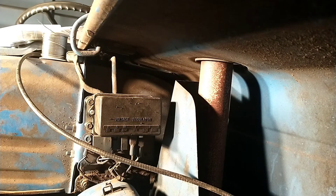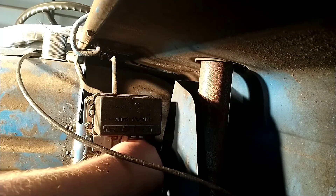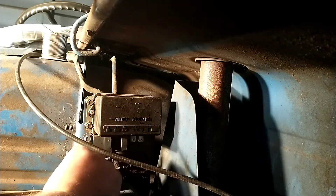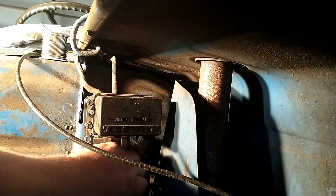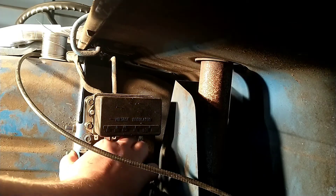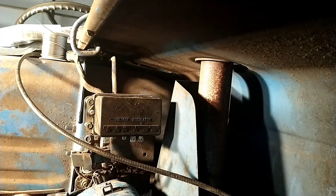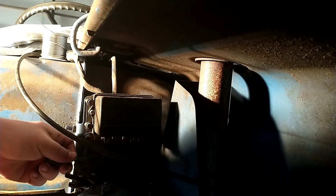The next step the instructions mention is to disconnect the wires labeled B — as in battery — and D — as in dog — and then connect all three B wires together. So we've got two wires that were my B's and then D is going to be a multiconnector. I can disconnect all these because the regulator won't be used anymore; that might make it a little easier to roll some of this out and work on it. So these two wires were my B's and this is my D, so I'm going to go ahead and clip those off so I can keep track of them.